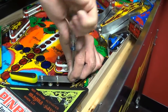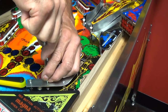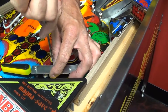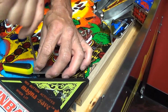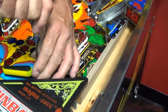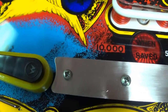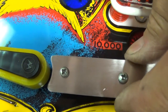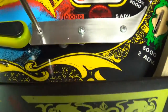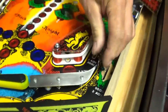Tighten it down 90% of the way there and we can show them where the slip is. I would normally add washers here, but because it's metal to metal it's not as critical. This is what you get - you can now slide it around, the whole thing back and forth. Just that little bit of play is going to give you what you want. You're going to bias the back down - depends on how bad your problem is.